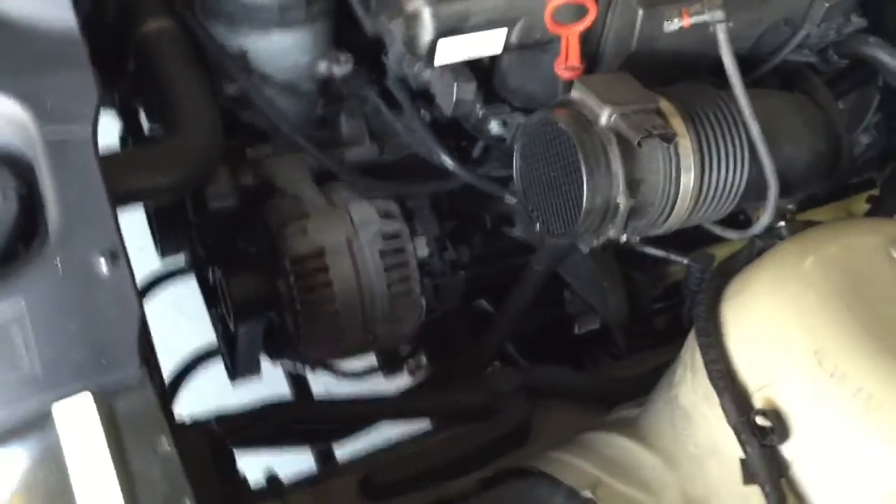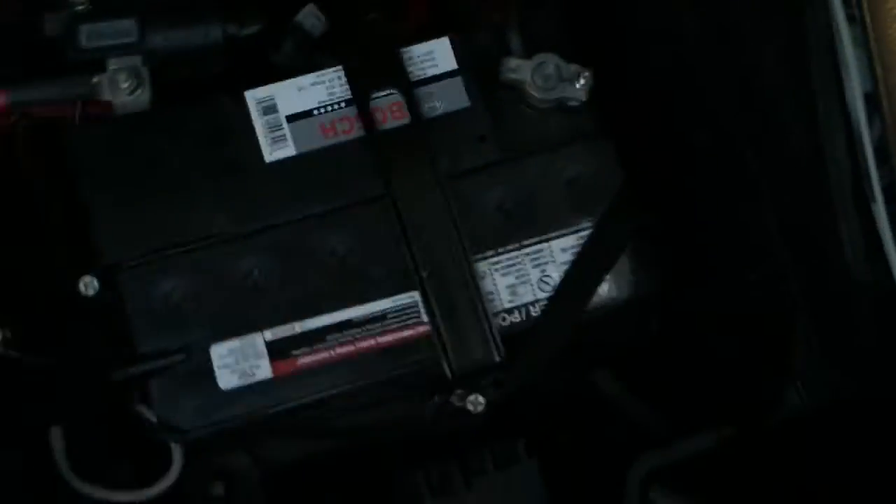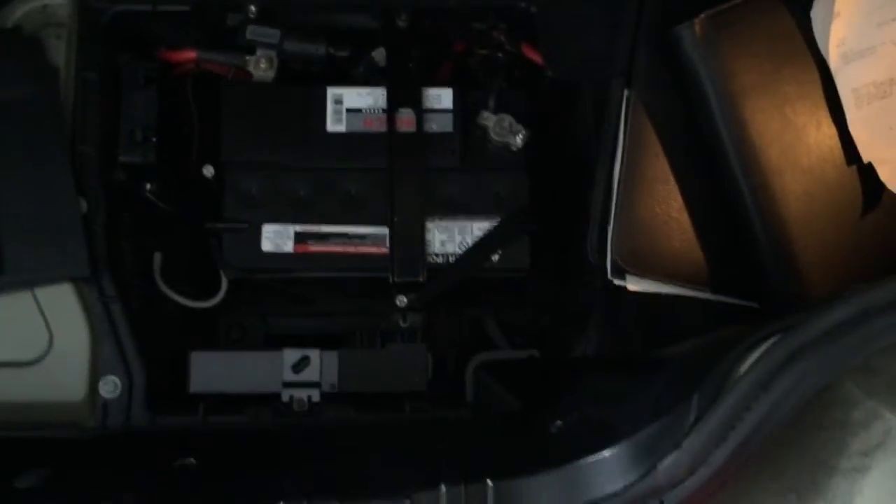Before I proceed, I'm going to disconnect the battery. This is a 2005 C4 — here's the battery. They say only to disconnect the negative terminal, but I'm going to disconnect both just to be on the safe side. Just unscrew that, it pops up, and then unscrew the other one and put some kind of cover on the terminals.